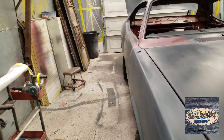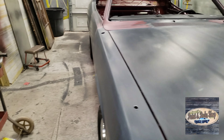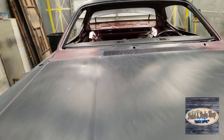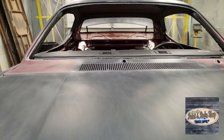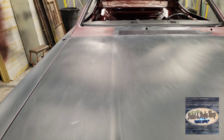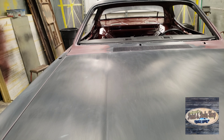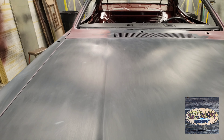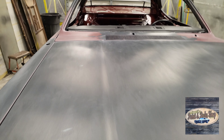I don't know if you can see it on the camera, but this car compared to the other side — the quarter panel dives in to the door. That tells me that car is pushed in still quite a bit, so I know this car had a diamond on it. There's the cowl panel — I don't know if you can see it — right in front of that vent, there's a hump right there. When I hit the side it bolted up. The original was on there and I thought there's a dent in it, like a bolt or something. So I cut it off and got the one off the '75 parts car, put that on there, and it laid down a lot smoother — but it's still got a hump in it, so that tells me it's really all whacked up.